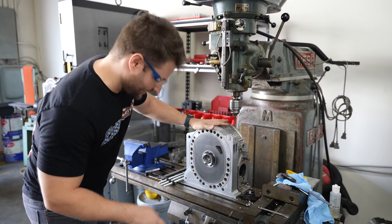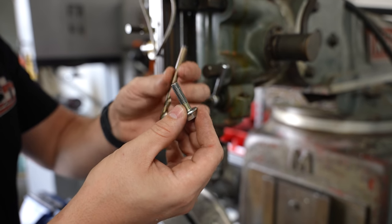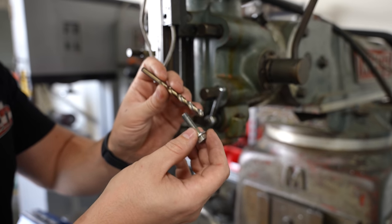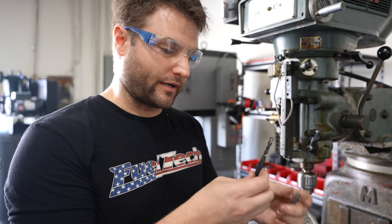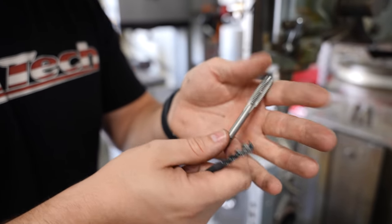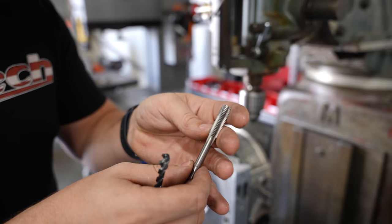The table is all the way down and the drill bit is just long enough. If you're ever going to tap M8 bolts, you actually use a 6.8mm drill bit. That's not the thickness of the outer thread — that's 8mm. This is 6.8mm, so you get the right amount of meat left. To tap the M8, I went and spent an extra couple bucks and got this specialized tap. This is probably the best combination of tapping ability for this situation. The traditional tap has all the extra metal from each thread curly-cuing inside, so you have to do a quarter-turn back, quarter-turn more, and so on.